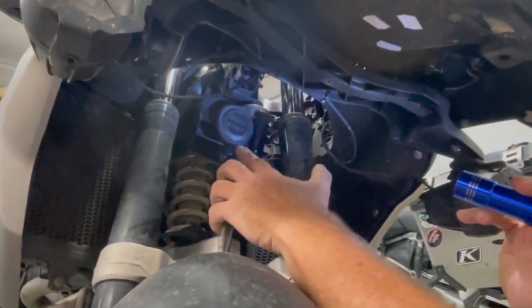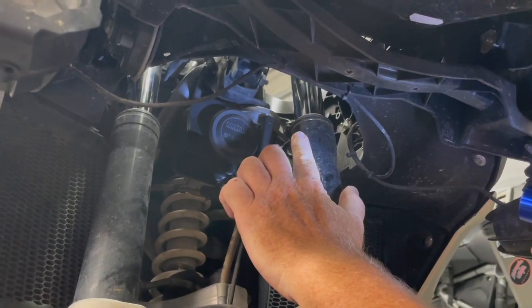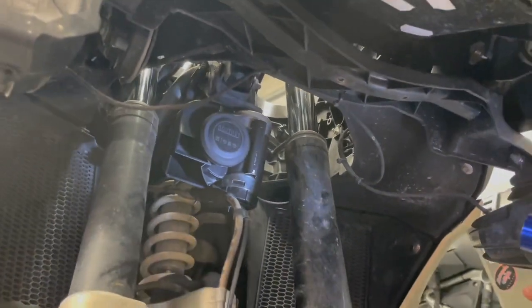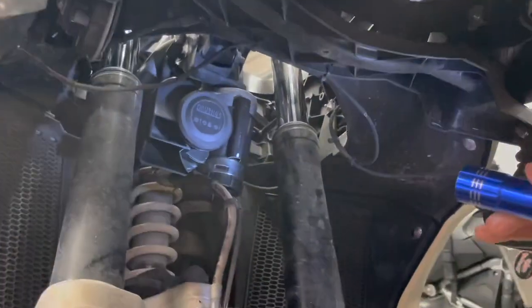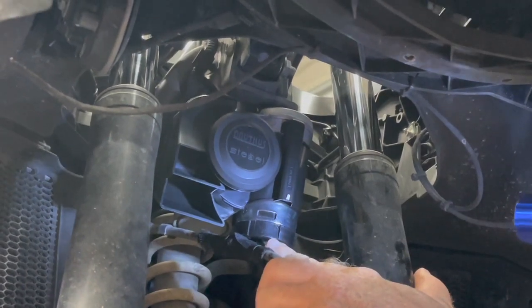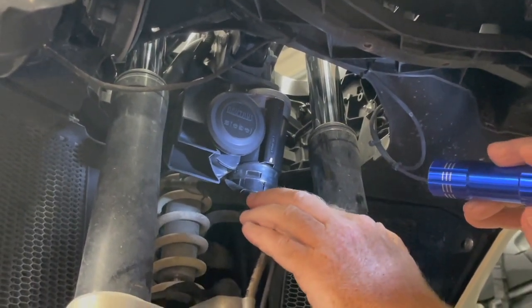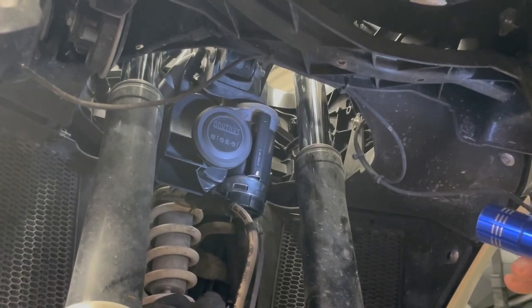Okay, so we have the horn mounted now up to the bracket. We've got the wire secured over the top of the mount. What you want to make sure is that you have free travel with the forks to go around it. The last thing you want is that horn impeding the movement of your forks. One other thing that Denali shipped when I got the bracket is a protective covering that goes over the lines coming down here, with a couple of zip ties, that'll protect them from any rubbing vibrations wearing through. So again, make sure that you have good, unobstructed travel on your front fork.